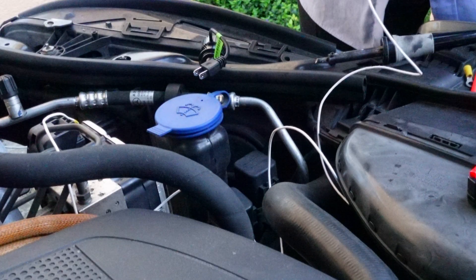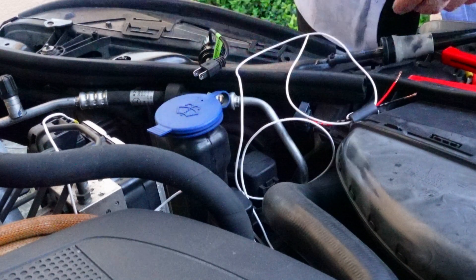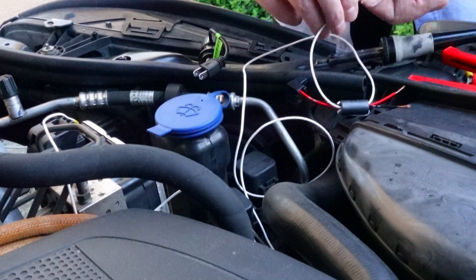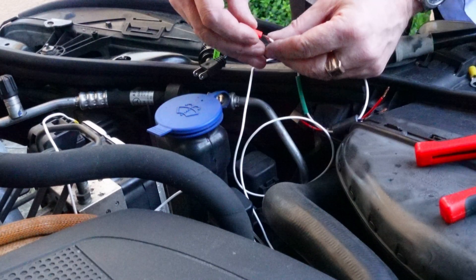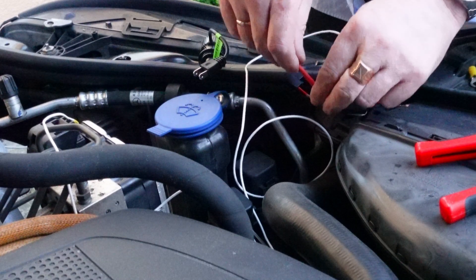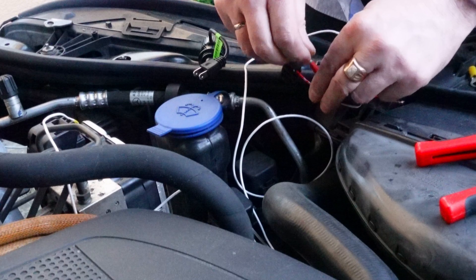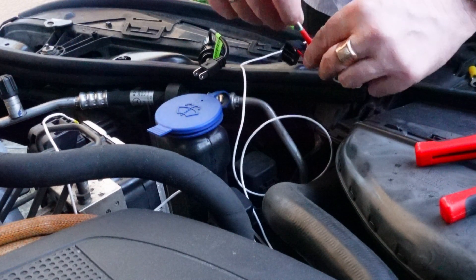This is how the brackets of the light unit look at the rear. We then have to solder the wires to prepare the connectors to the light bulbs. Because I use LED bulbs, I run their wires through the ferrite cores to try to reduce the interference from the LED bulbs, and I would strongly advise to have this.